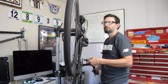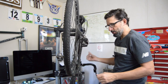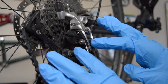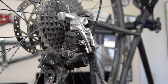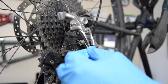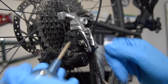First we're going to shift all the way to the small cog, then disconnect the cable at the rear derailleur and at the brake caliper. This bike is super grungy so I went ahead and got the blue nitrile gloves on. On these SRAM clutch style derailleurs, if you can lock that thing out of the way it makes it a little easier to work on. These little caps you can usually just squeeze off, or the quickest method is just to cut them — usually gives you a cleaner cut.